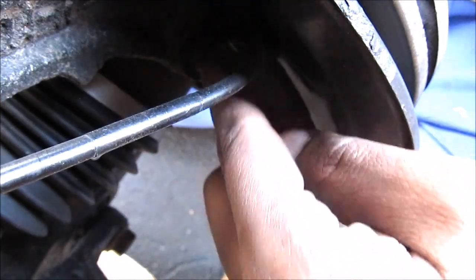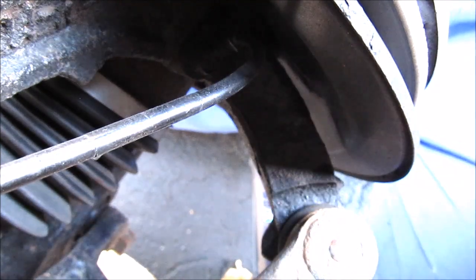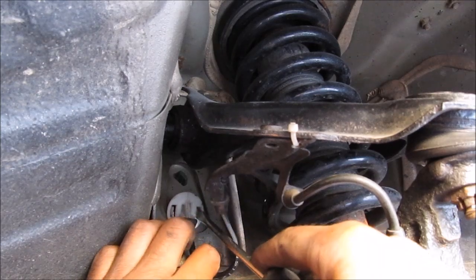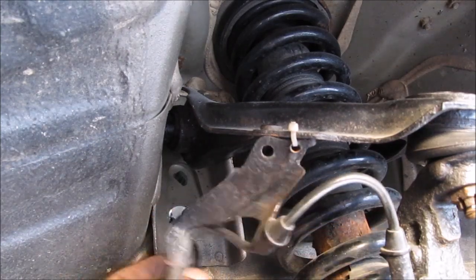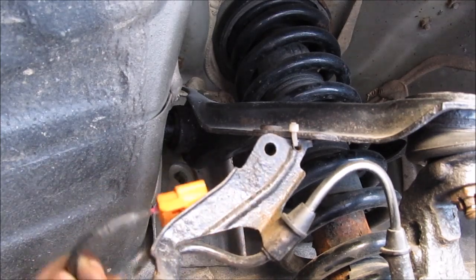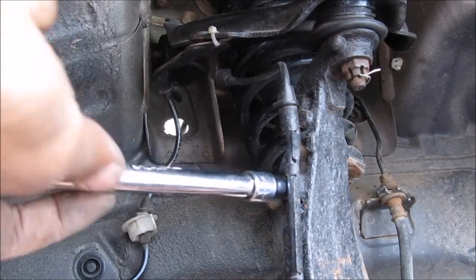It comes out to this bracket and then goes down the steering knuckle. If you follow this line all the way down to the steering knuckle, it goes to this 10mm bolt that holds the sensor into the steering knuckle. Once the sensor is disconnected from under the hood, I can come in here with a flat screwdriver and push these tabs to pull out this white bracket and then the entire sensor from the body of the car. That gives me access to the plug, and I can remove this 10mm bolt that holds the ABS line to the steering knuckle.